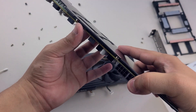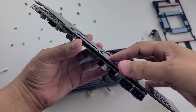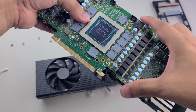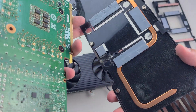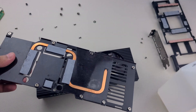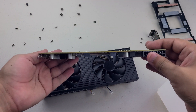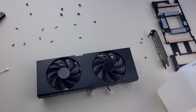I don't know if you can see it now, but this thing is so warped. It's either the board that's warped or the actual plate. The thermal pads aren't making any contact — you see that gap? Even if I press down on it, still no contact. I think we're still gonna need thermal pads that are a little bit thicker for these two areas. But it's clean now, so let's at least put the other pieces together. I'm pretty sure the board itself is also warped — it has a slight curve to it.